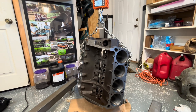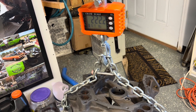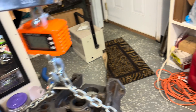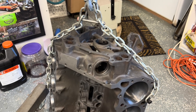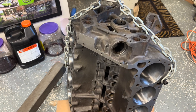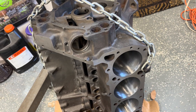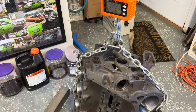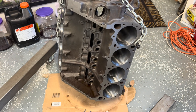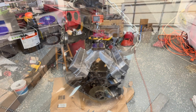Let's look at that comparison. If you will recall, that 400 block was 213.4. So right at nine pounds difference between the low deck and the high deck, or tall deck. That's pretty interesting. This block is more of the same — I believe it's 30 over as well. About nine pounds less with a low deck and a little bit easier fitment. But I've got to have a 440 for my Challenger.